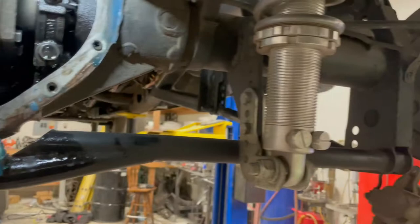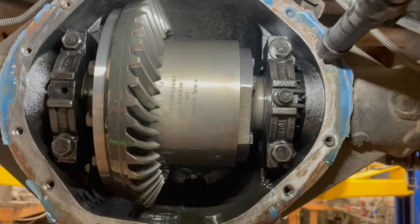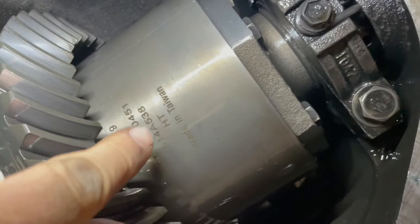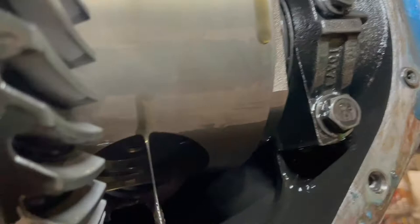For those wondering, this differential came out of a 2008 Vortec Max 1500 — that's where you get the disc brake combo with the 9.5, and it bolts right into your leaf springs. I got this for a pretty good deal, about 750 bucks. You can tell this is a True Track — it's been a really good differential, no issues, it hooks up and goes. We've got the transmission in neutral to expose our spacer plug and we need to grab snap ring pliers.